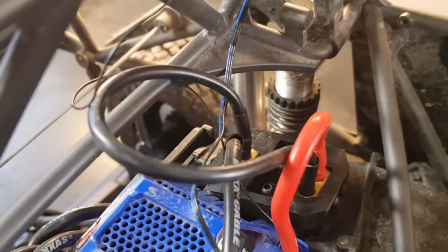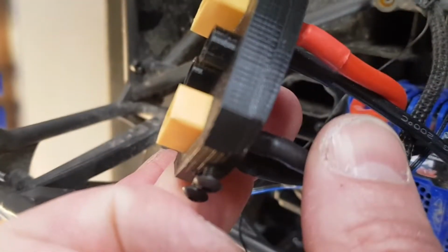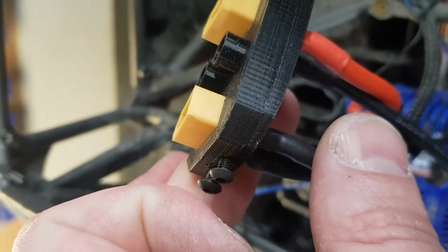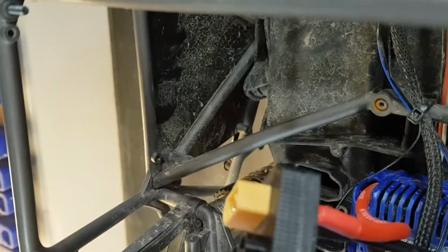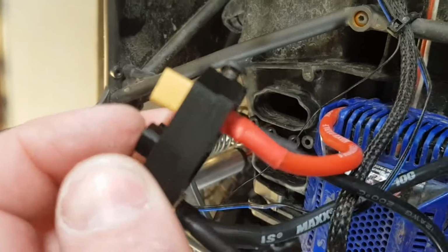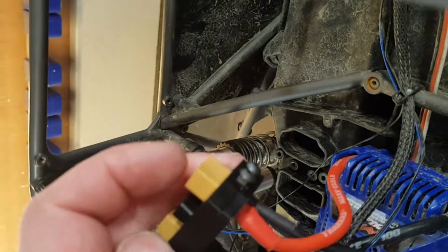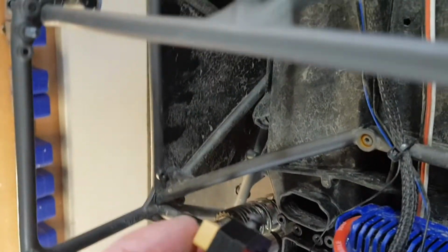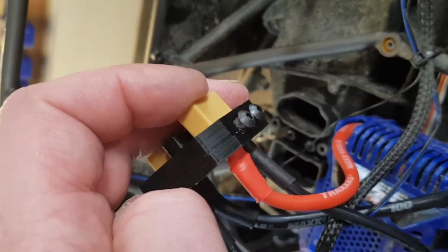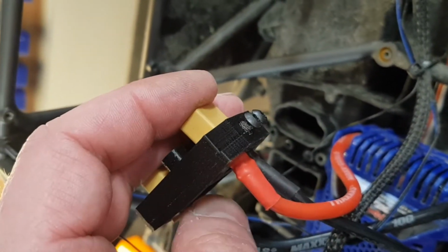It's going to be a little bit of soldering, a little bit of unscrewing of some components. Pretty straightforward. It's a pretty easy fix. If you can use a soldering iron, you can do this. So we've slackened off those screws, both sides, and they're a good tight fit. I can guarantee, and I know this from bitter experience, if you don't tighten them up well, when you go to plug in your battery, you'll use the force to plug the battery in and the connectors will disappear up into the car and it's then almost impossible to get your connectors joined. So make sure they're nice and tight.